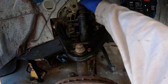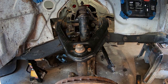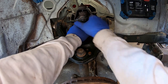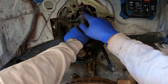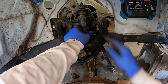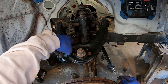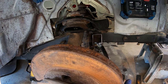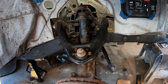I went ahead and threw in the stock Nissan hard-body shock — I think it's original from 1995. There's full droop — it hits there. The shock is maxed out. Because if the shock was tight it would have limited the travel. So that is a good place. Now up travel — there's fully bottomed out. The suspension and the shock bolt bottom out at the same time, and there's zero clearance issues. Perfect — can't get better than that.